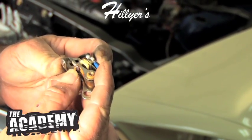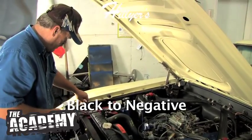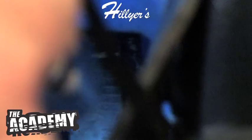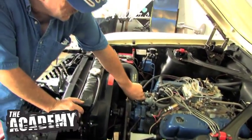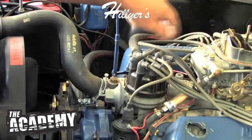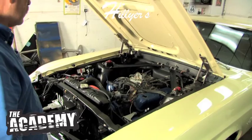Put the lead to the number one spark plug, red to positive. By the way, you need to clean your positive cables — actually both battery cables. The harmonic balancer has stamped numbers on it all the way around, and then there's a pointer right there. When we start the car up, we'll put the timing light on it and make sure that pointer is pointed to that white mark right there — then the timing will be right on it. We'll pull the vacuum hose off so that we don't get any advance; that way when we start it, we don't get the vacuum advance changing the timing while it's sitting there running. It shouldn't move much when it's idling, but if you rev it up at all it'll move the vacuum advance.